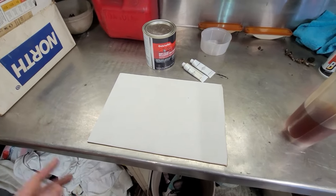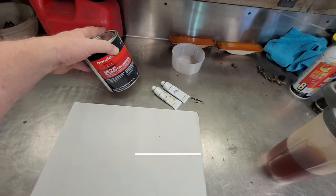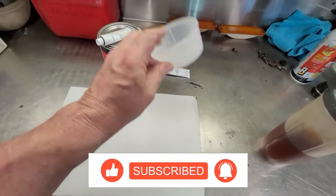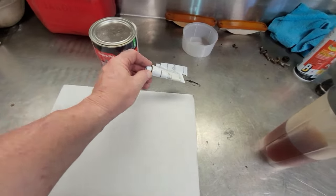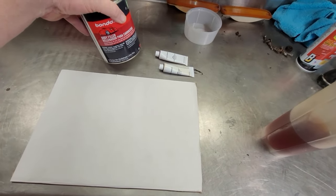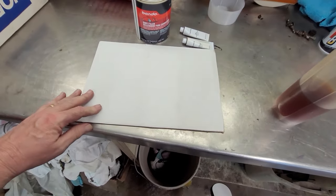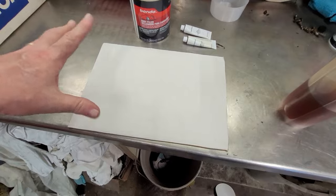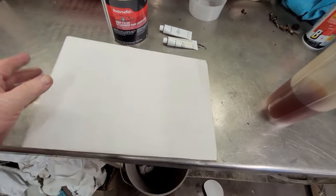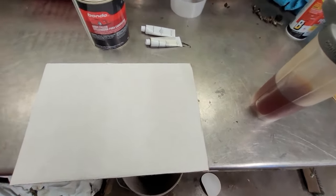Okay, I don't know if you guys care, but this is kind of what I've always done. And I've always used Bondo brand because I've always been just a home guy doing it. When I buy Bondo, it comes with one can of hardener in the little cup. Well, the little cup never gets used, but I always buy an extra hardener because there never seems to be enough hardener with the can of Bondo. So you always run out of hardener before you do the Bondo. And I always use a piece of cardboard, and I usually try to go something a little longer than wide so you have something to grab a hold of whenever you're scooping it, so you're not getting your hands in the middle of it. You can make your pad, your pile here, and you have something to grab a hold of, scoop it off of, and spoon it.